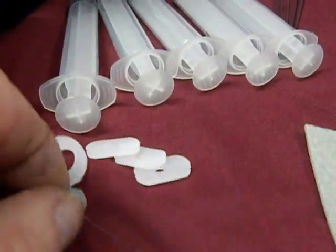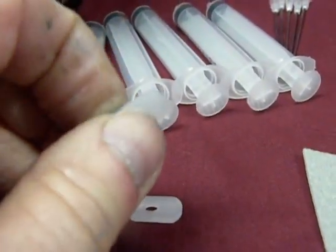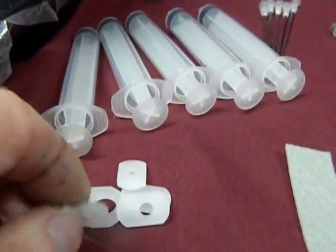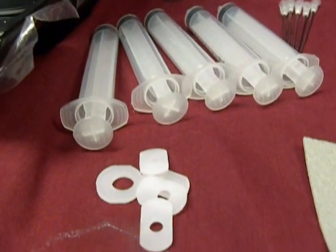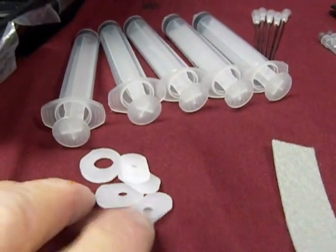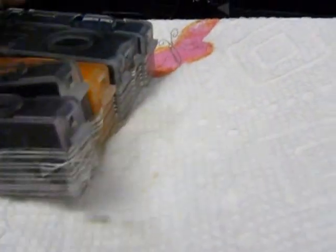Get all your clips off and save them. Now with the CIS, you get rubber gaskets for the printhead. Put them in there should you have any air leaking from the cartridge. I'm not going to put them in because I found I don't have to. But if you find you have a problem, remove the Canon gaskets and put them in the printhead — you can take the printhead out to do that. Check your printed instructions for more detail about that.